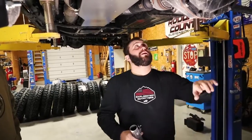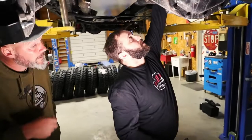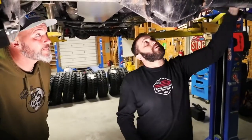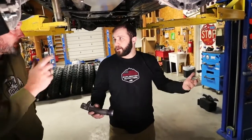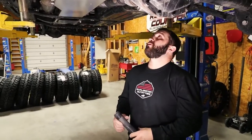You'll have to tie into the EVAP system. On the side of the tank here, there is a clip. You'll replace this hose. It runs out here to the outer fender. You'll replace that, and you'll put a 90 in on a rubber hose, and then you'll run that over at the top of the tank, and it allows venting for both of them. So you've got air and everything like that. It's a pretty straightforward process. If you've ever done any type of auxiliary tanks, then you're going to know everything you got to do for it.